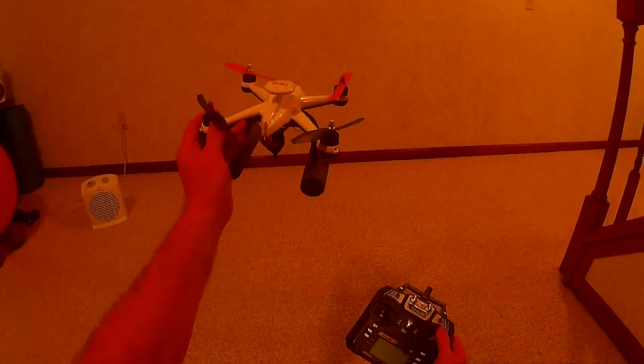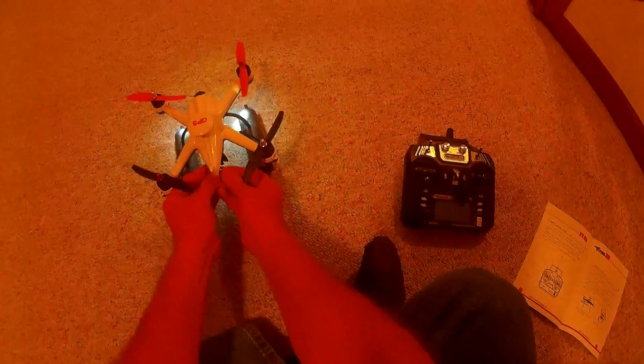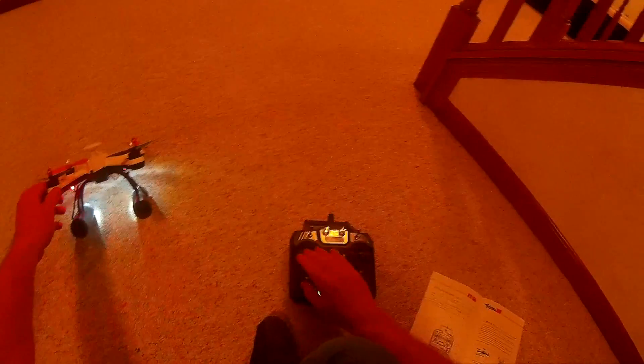Okay, we're going to do a quick compass calibration of the 3DX6 — that's what you need to do first before you really start flying this. I'm going to go ahead and turn it on and tuck those wires up. We want the lights to go solid or flashing green. I'll turn the transmitter on and use switch A, toggling it rapidly until we see that.